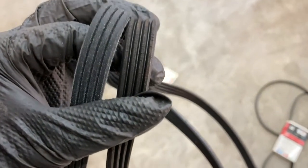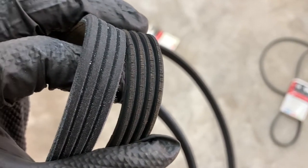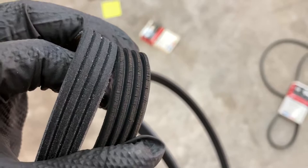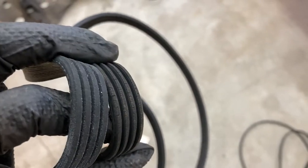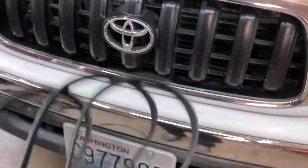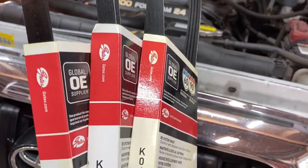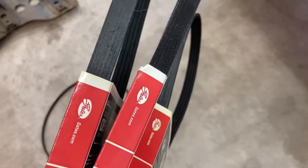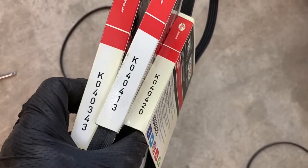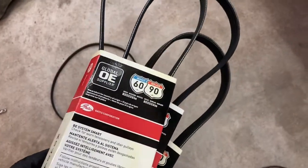And here's just a little comparison of the new belt on the left and the old belt on the right. As you can see, the old belt on the right was starting to crack, and it feels really, really dry. So it was just a matter of time till this belt was probably going to snap. I know a lot of people prefer to use OEM, and they'd rather just go with the Toyota belts, but I went ahead and purchased a couple of Gates belts. I've used these on some of my other vehicles, and they seem to hold up just fine compared to the OEM belts. I'll put these part numbers in the description, along with the part numbers for the OEM belts if you prefer to use those.